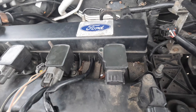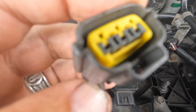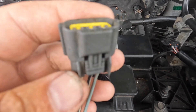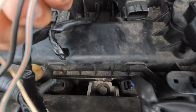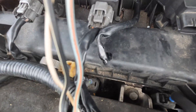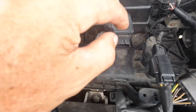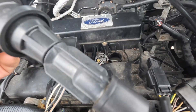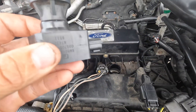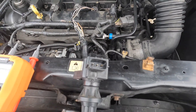Next thing is to try and find the fault. We've got it down to this area, so I fully checked the contacts — we've got good continuity and power coming through. I stripped back all the wires, thinking maybe I'd kinked a wire when pulling it off, and went all the way back down. Absolutely nothing — the wires are all in great condition. So I moved on to checking inside and pulling out the coil pack, making sure nothing was rubbing or causing a problem inside. Again, nothing there.